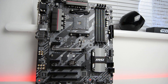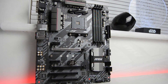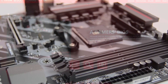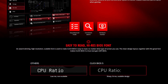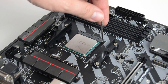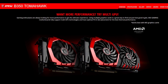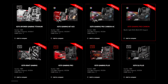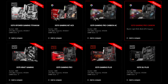So what are my thoughts on the B350 Tomahawk? This is a great looking board with some really good features, great value for money and very stable with the latest BIOS installed. The BIOS was really easy to use and I easily managed to overclock the Ryzen 3 1200 to 3.8GHz with no issues whatsoever. Crossfire support is also nice to have, but if I was going to go in that direction I'd probably look at an X370 board instead, as the extra performance gain would be worth the slight increase in cost.